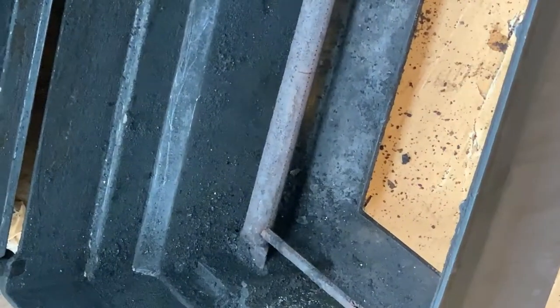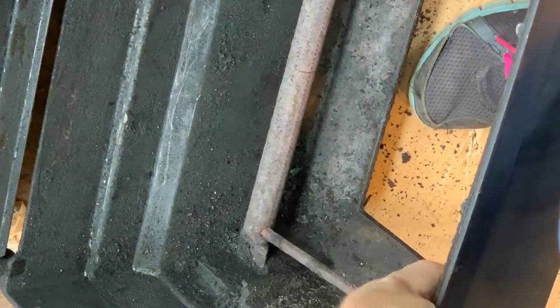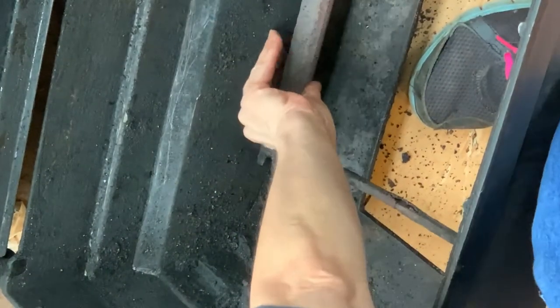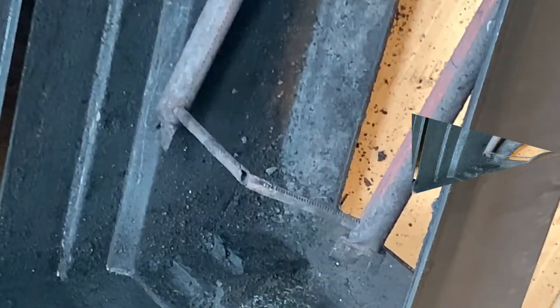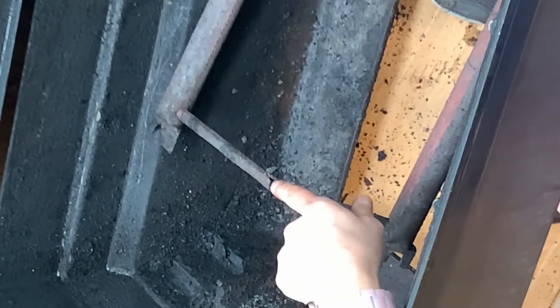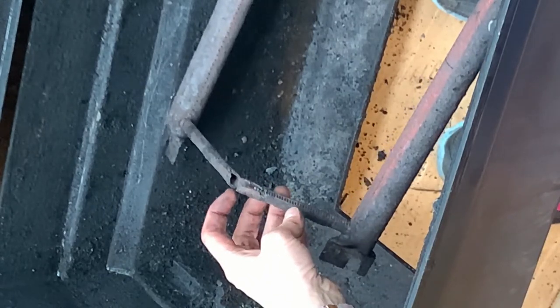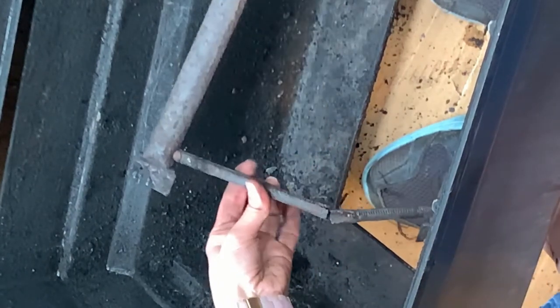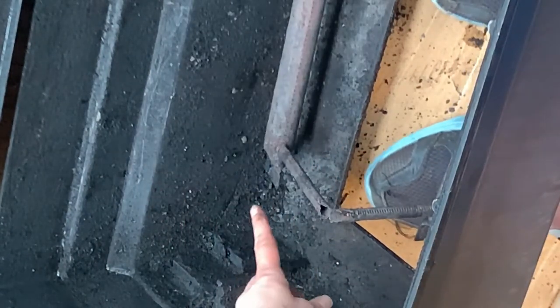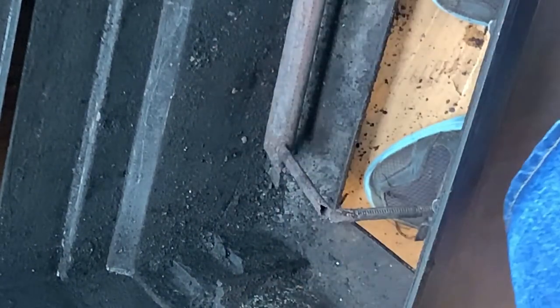I saw in the instructions that they just slide out, and you do not need to unscrew them. See, they simply slide out. As you can see, this is where the hole in the original burner tube, which started this whole process, is. That is what made this crack in half. Technically, I'm supposed to be able to slide this off. This is a little rusty, off that burner tube and this burner tube, thus freeing the burner tubes so they can slide out of the whole box.